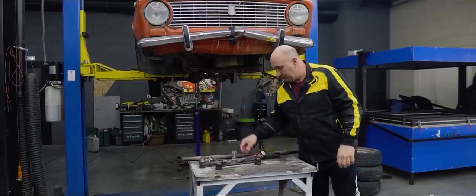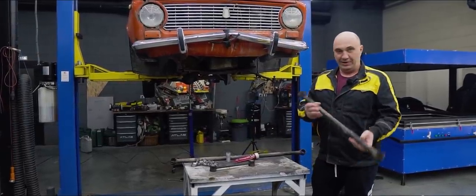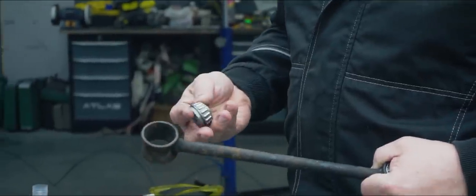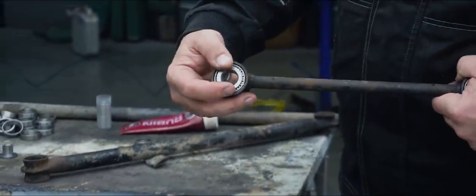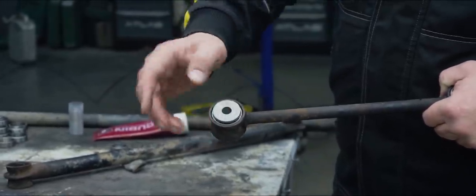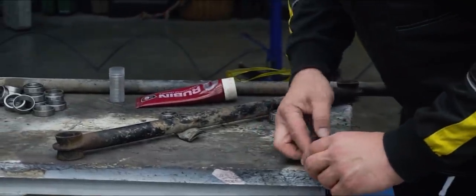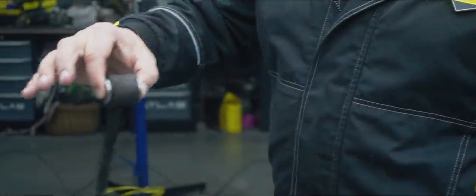Here's the situation, fellas. We've removed these links. This particular one is a trailing reactive arm. We went and pried out the bushings. Now as you can see, this is slightly tapered. We went to a store and found these bearings - just look at that fitment. They both have a slight taper, so they're a perfect match. Next, we machined some grommets which we insert on one side. So we insert the bearing and grommet, which results in this nifty deal.